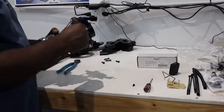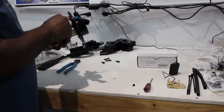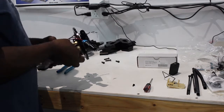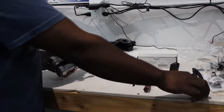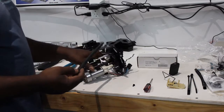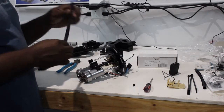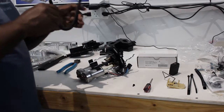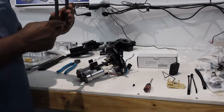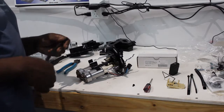You might wonder how to get these to go on because they're really close to the fittings. Well, that's why we give you the really nice, unique flex hoses. These are all E85 compliant. They won't kink. They can handle extreme angles because they're convoluted, so they operate as a flex. You can actually get to a really tight bend on these and you won't get any kinking, which is why we supply these versus standard fuel hose.